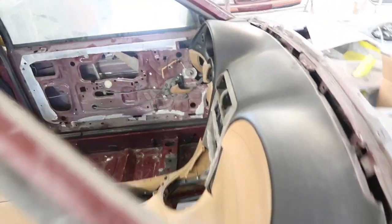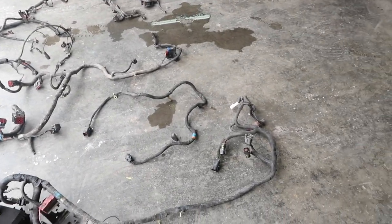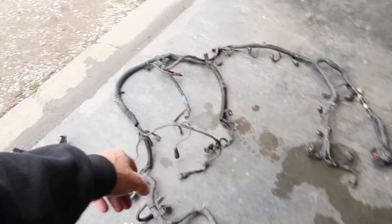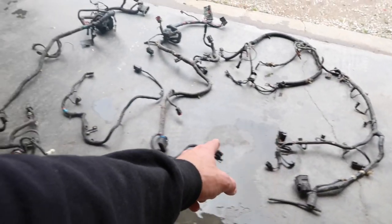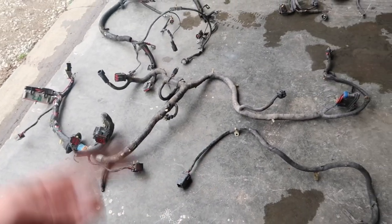Anyway, I just wanted to show you guys this SN95 dash — I'm going to be working on this so there's going to be another video coming up really soon, probably by end of the weekend. This is the 94/95 wiring harness I'm running in the fox body: engine bay harness, five-speed transmission harness, this goes under the dash to the computer, and that's another engine bay harness. There's the positive and negative battery terminal harness, the injector harness, the dash harness, and the other complete dash that'll be running. I'm going to clean these up because they're all nasty — took this out of a 90,000-mile 94 GT that I parted out.